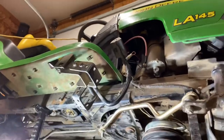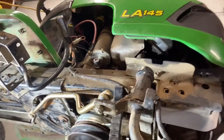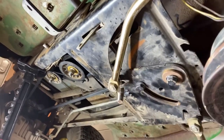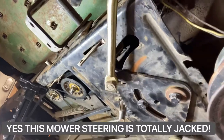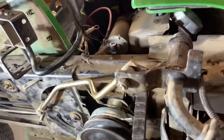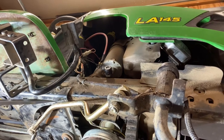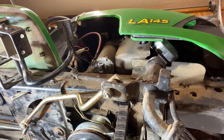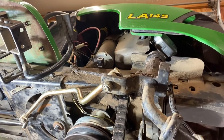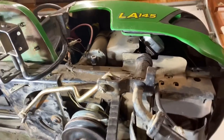First, just to give you an overview of what a drag brace does: it starts up here, the drag brace connects to the front wheel hub and runs back to the steering. Underneath, as you turn the steering wheel, it turns the drag brace which turns the front wheel hub. Now this drag brace here is totally jacked up — that bend is not supposed to be there. We had a bit of an issue at the mower rack when I flipped the mower and we definitely bent a drag brace, throwing off the steering. So what we're going to do today is replace it with a much improved drag brace.